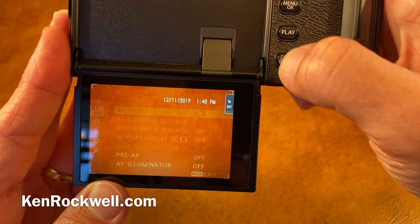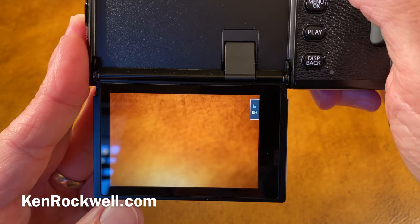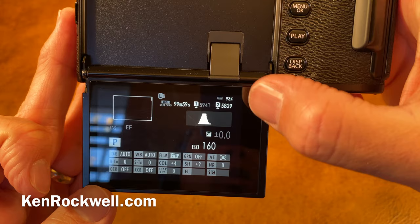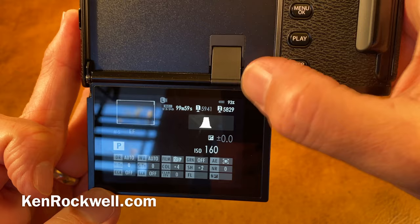To see the battery percentage, it's very well hidden, but there is a way to see it. What you do is you keep hitting display back, and only on this rear screen, and only when you're idle — not when you're shooting, not when you're playing back. If I tap on the shutter, the battery percentage appears right there. That's the only place you can see that — you won't see it in any of the other displays that are on playback.